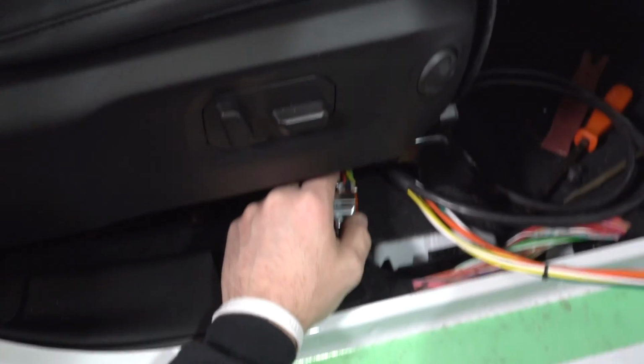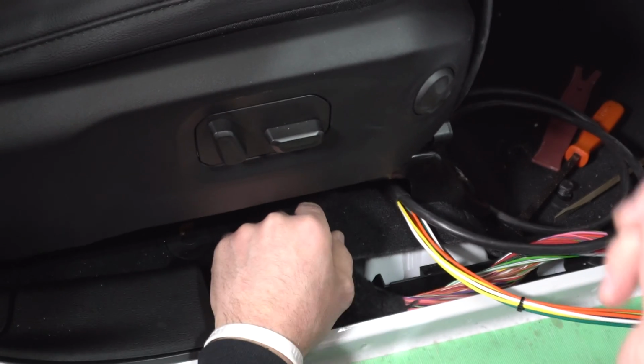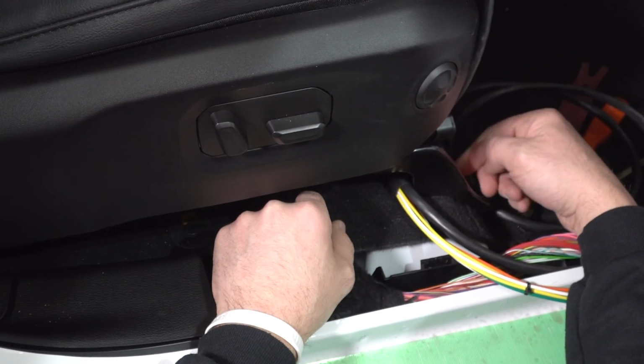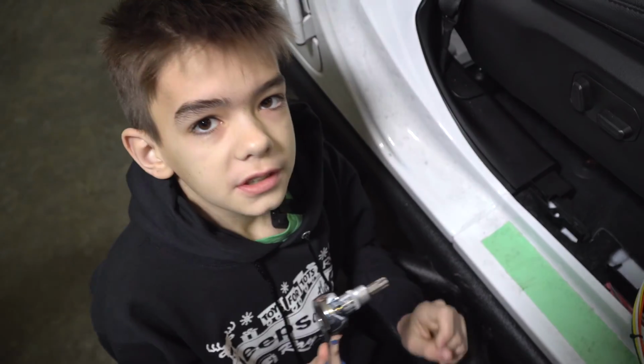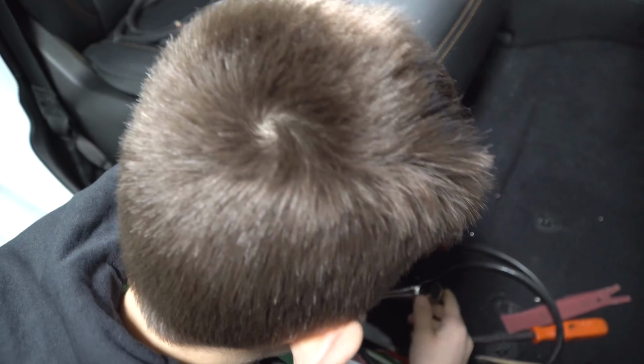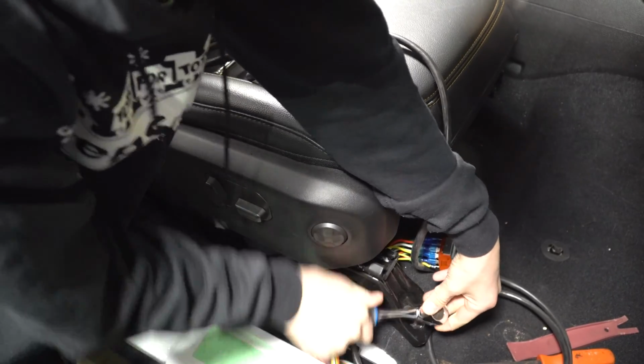All right, Charlie, will you grab the Torx and I'll have you pull this seat out, okay? Or pull this bolt out. It's really just the front 2 bolts. You can lean it back or even just this 1 bolt, and we'll talk about that in a second. Torx, it's a T50, and we're going to be removing this bolt right here. There might be some Loctite at the end of it, so it's going to be a little bit difficult to get it off, but... Thank you.